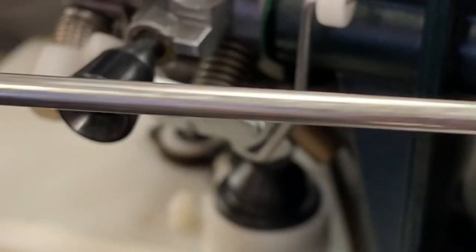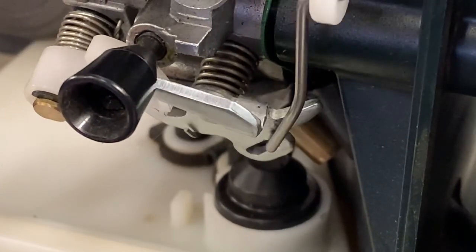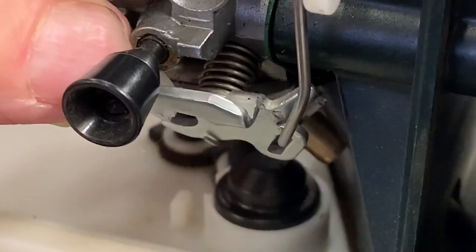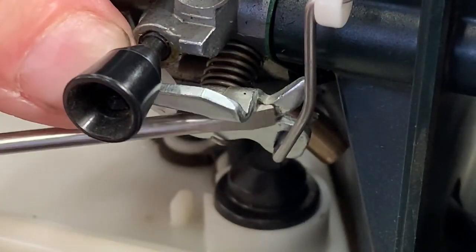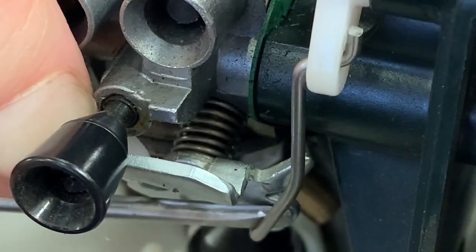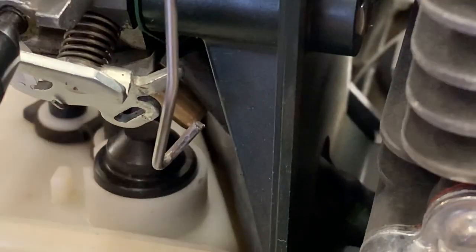What I do is get one of these little steel screwdrivers and manipulate the throttle to where I can catch it right here with my finger like that, and then get your screwdriver in behind and twist — and it'll come right out where you can remove the carburetor.